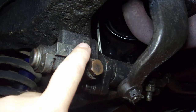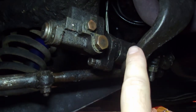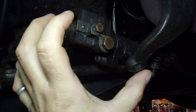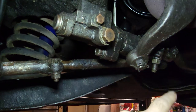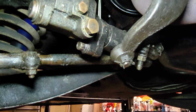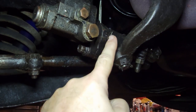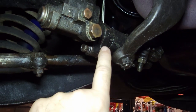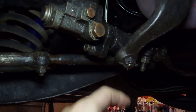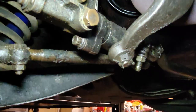So these are where the power steering lines came out, in and out, and went to the ram that was on the other side. And this is your control valve that controls how much pressure you're actually putting on the steering to tell the ram that was on the other side that we talked about earlier how hard to push or pull. Without that, this just connects and has an end plate here, usually. From what I understand, I think this end piece here is different on the power steering versus the manual. But I'm laying underneath here, and I'm watching when my brother was turning the steering back and forth. He's gone now, you know, because I ended up putting it back up on the lift.